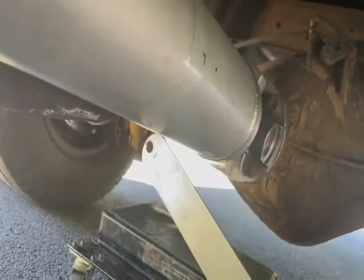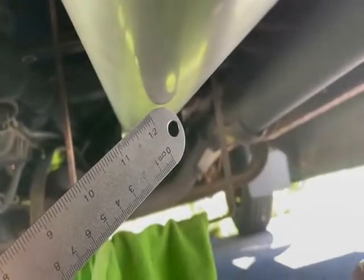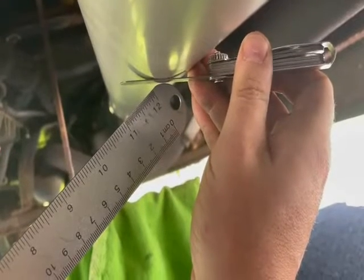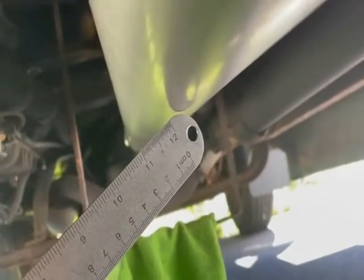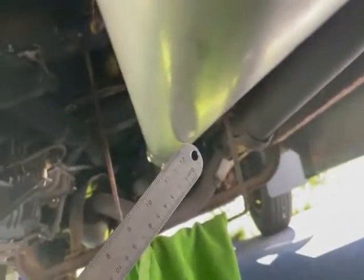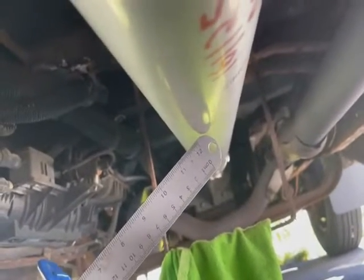You also want to measure the middle of the driveshaft. At a different spot, same number — twenty-five thousandths. This one is twenty-five right on the money; the other one was in excess of twenty-five. That's right at the upper limit of what a lot of manufacturers will specify — it's tolerable but this is sloppy craftsmanship.